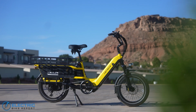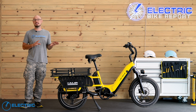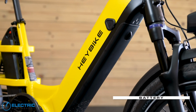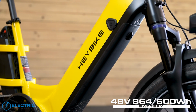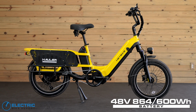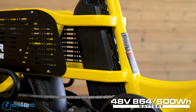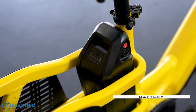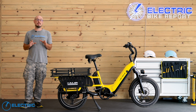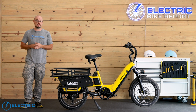Business aside, let's get into the nitty-gritty and talk about a few highlights from the Hauler. I do want to start off with price, since this is one of the most affordable cargo e-bikes we've reviewed. The base model, which includes a single 48-volt, 864 watt-hour battery in the down tube, is priced around $1,500 at the time of filming. We were sent the dual battery version, which includes an additional 600 watt-hour battery slotted in behind the seat tube, and this spec level is priced right around $1,700. Both price levels are about as low as you'll find for a cargo bike, so this one should be on your radar if you're shopping on a budget.